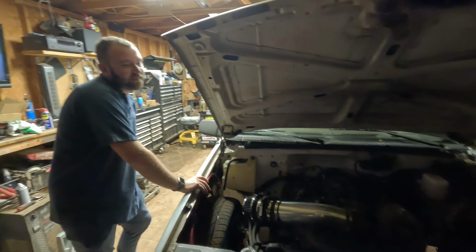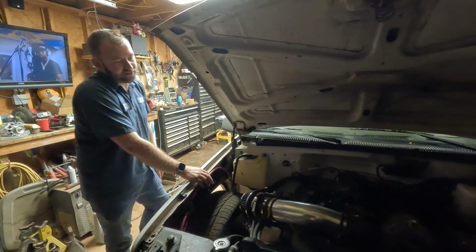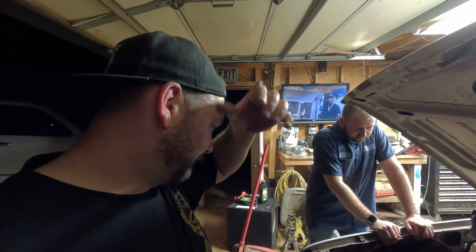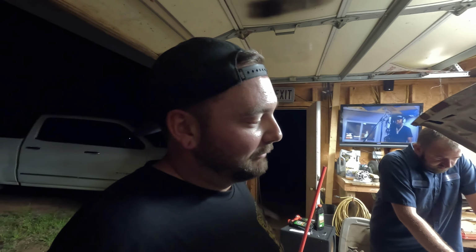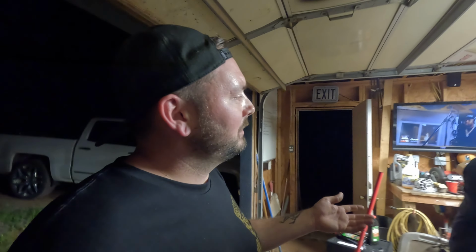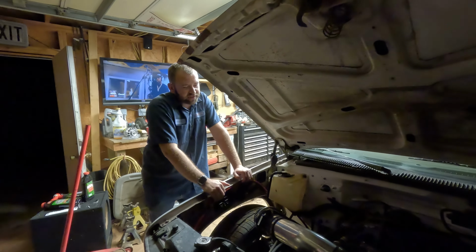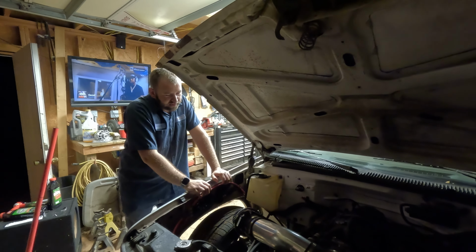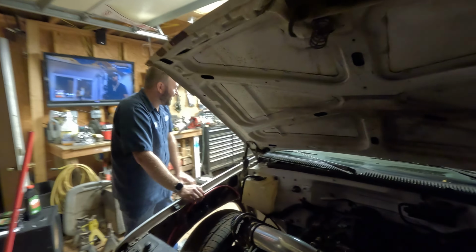I think I have a set of 7.400s at the shop. Okay. I'll check tomorrow when I go to work. Yeah, so we're going to try different push rods. That would make sense to me, because if it's pushing it too far down, maybe it's not letting the cam ride the way it wants to. It doesn't ever have a chance to pump up. The lifter, it's essentially like a solid valve train right now. It's not right. And that ain't right.